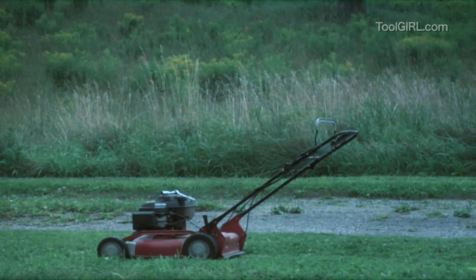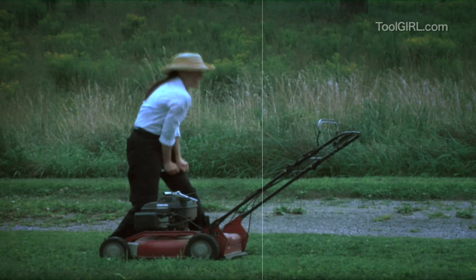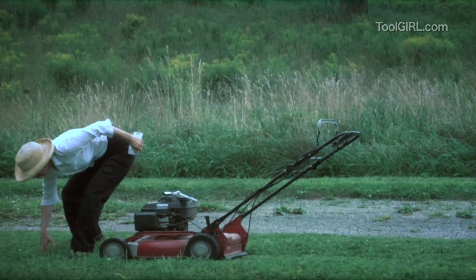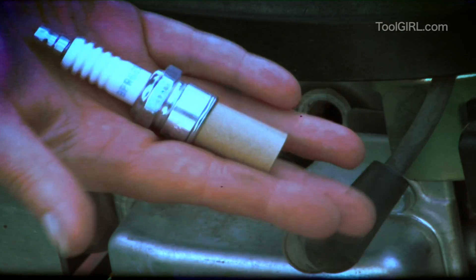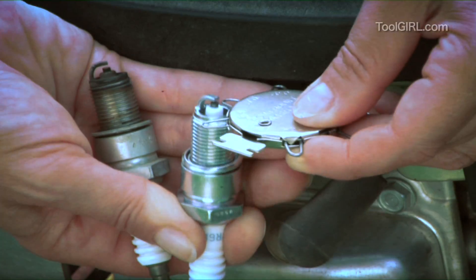And we're back. I've also got — very proud of this — a feeler gauge. You're gonna find out how that works in a second. Sadly though, they're blister packed, it's a little hard. Oh, will she find it? Yes! So there's the new spark plug, and there's the gap at the electrode that has to be the right distance. That's what the feeler gauge is for.